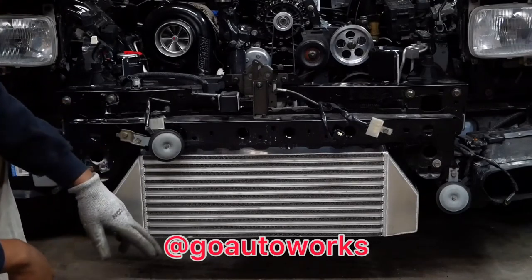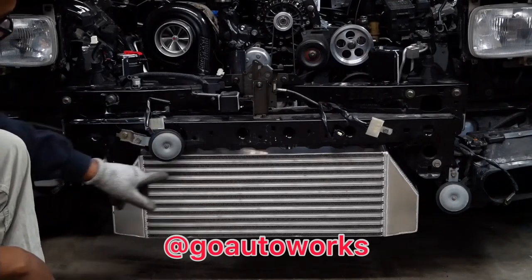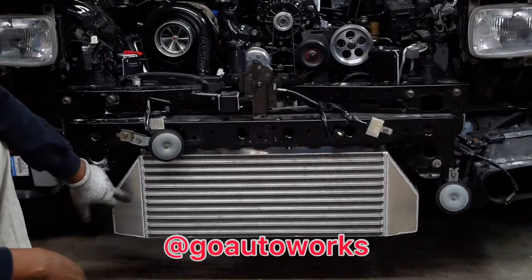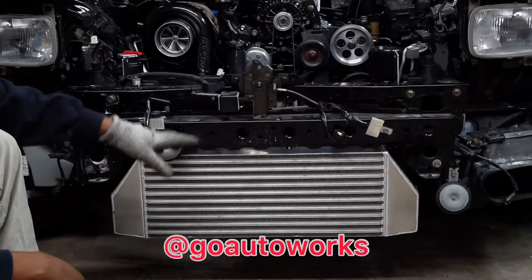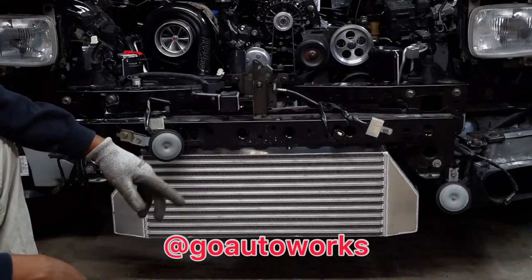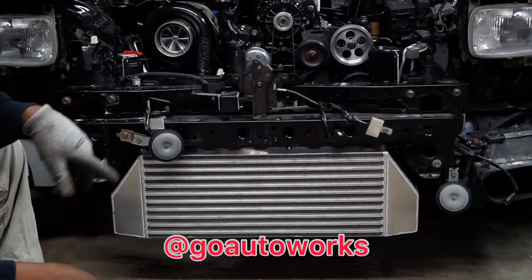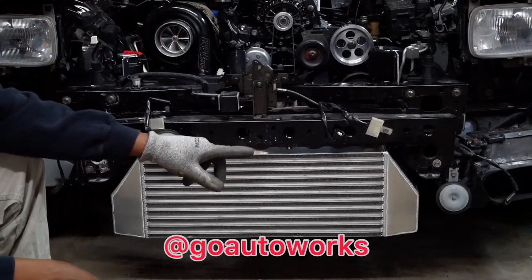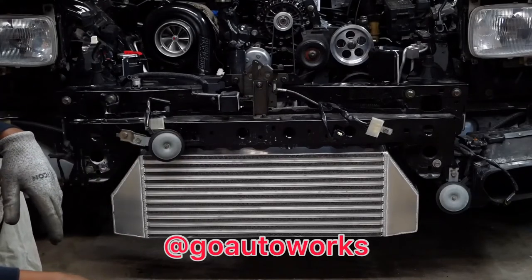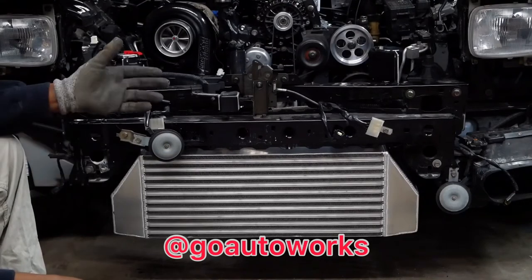I've got this all bolted up how I want it, and you can see one reason why I went with a 9-inch core instead of 11 or 12 inch like what was on it before. It's because when you're going thicker, you've got this ridge right here and the shape of the bumper support or frame rail right here. So I wanted to make sure I could get it all in using standard 3-inch long tanks and still have good clearance all the way around, while still using the same mount locations it already had. Next I'm going to put the inlet and outlet on it, which are going to be 90-degree turn backs using the Vibrant clamps. This side is tighter due to the old cooler on the car, so I have to work around that and figure out how to make it still be symmetrical. The core and bases of the intercooler are done - it all fits well, and the AC condenser and radiator will still bolt up how I want them, so it should all line up well in the car.